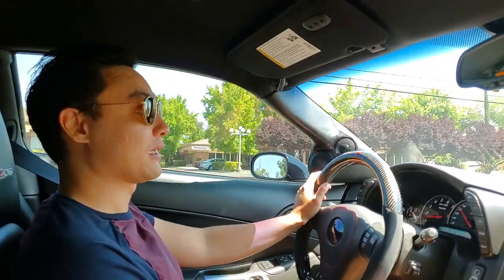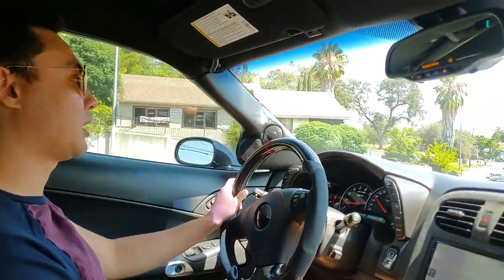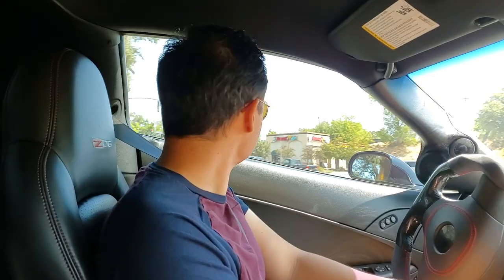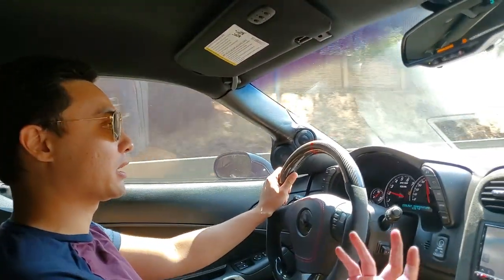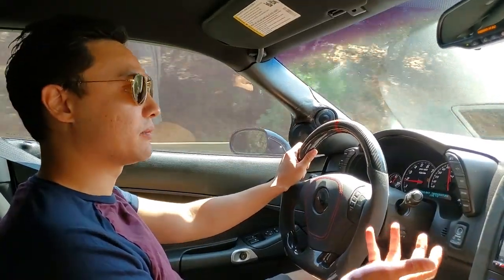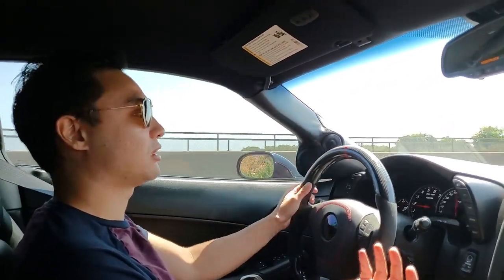It's just fantastic driving around with the cam car. It feels a lot more special — it feels more of an event, especially with the cam. Right now I have my foot off the throttle at about 1500 RPM. That's a pretty sensitive spot in the tuning as well. If you don't have a good tune on the car, the car is going to want to buck when your foot gets off the accelerator. I would say this camshaft is definitely more dependent on the tune itself. You start going to a bigger camshaft, you end up with a tighter lobe separation angle and you start to give up a lot more on drivability.